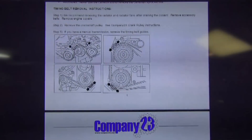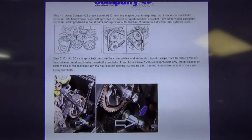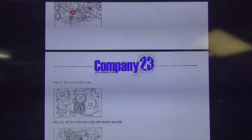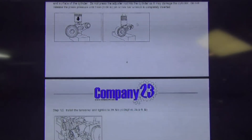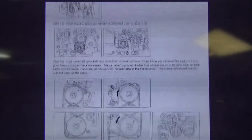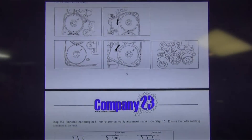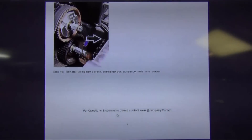They have downloadable instructions that'll show you how to do a timing belt job — all that legal crap doesn't scare them, they give you the instructions anyway. They tell you how to put the tool on, how to tighten it properly, how to take the timing belt off, how to compress your tensioner. You can use an Allen key — I like to use a drill bit; drill bits are usually a little bit harder and the sizes are easy to find. They give you the torque specs, helpful information — everything you could ever want, with better illustrations than you find in a lot of the automotive subscription services you have to pay for as a mechanic. These guys are here to help you and they have tech support. I email with them and they respond to your emails. They're awesome.